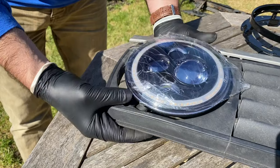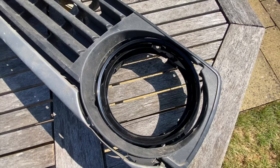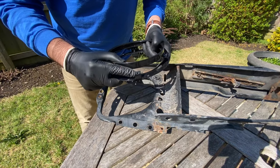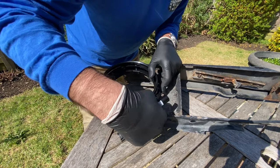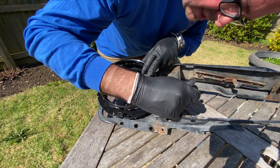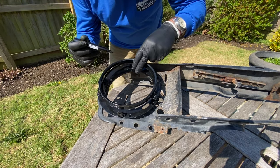There's actually plenty of room for the headlight to fit, so that in itself isn't a problem - we've just got to get it mounted to the front panel. The mounting ring fits quite nicely in the headlight aperture of the grille, so we might have to cut some bits off, or we might not. To fit the mounting ring to the front panel, make sure the little tab is pointing straight down - really important, otherwise your headlights will be wonky. It catches on the Mark II front panel at the three headlight adjuster points, so you need to trim the front panel back in those three places. I'm going to use a permanent marker to draw around it so I can see exactly what needs trimming.